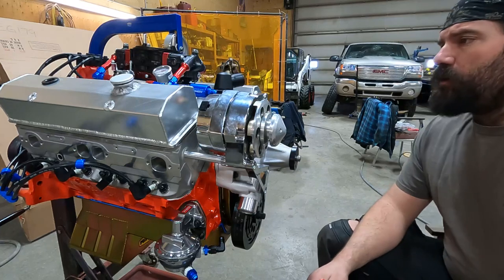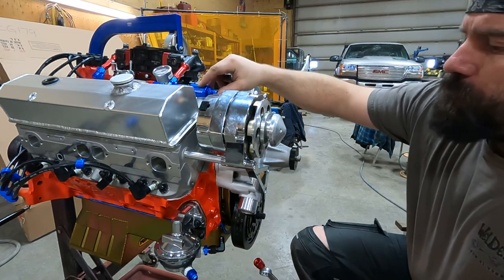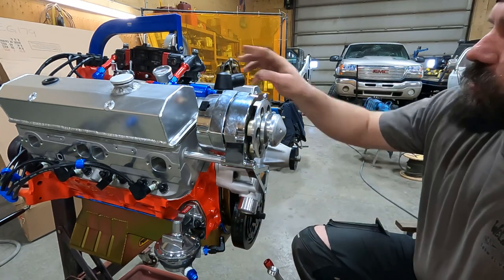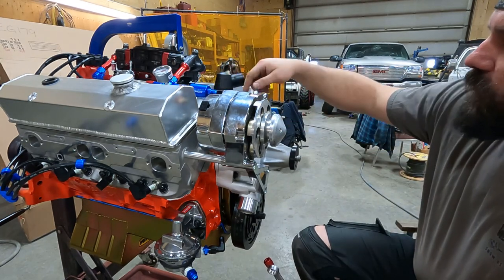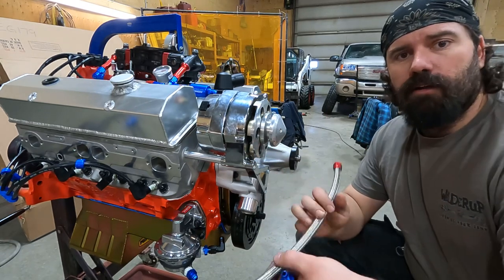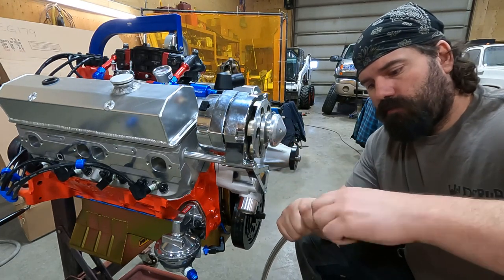I had to jump ahead a little bit here, the camera died. So I got my fuel lines on the carb, fuel pressure gauge in, I'll mount the filter up here. I've tried a few different configurations, putting the filter down here closer to the pump, and nothing really fits well. This is the best way. So now I gotta get the line to come from the end of the filter around in behind the water pump and down here to the fuel pump. So just putting together the fuel line here, that end done already. The first fitting on. Just have to thread the two halves together now.